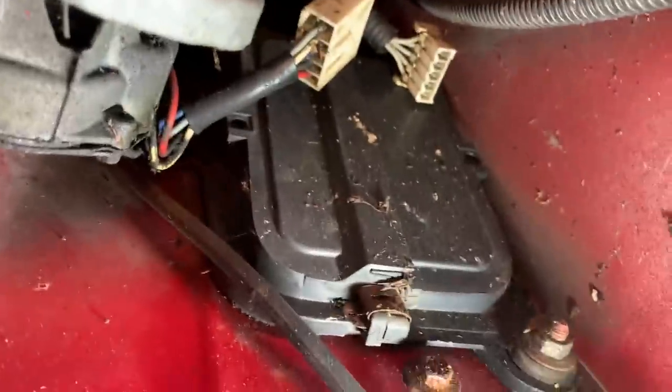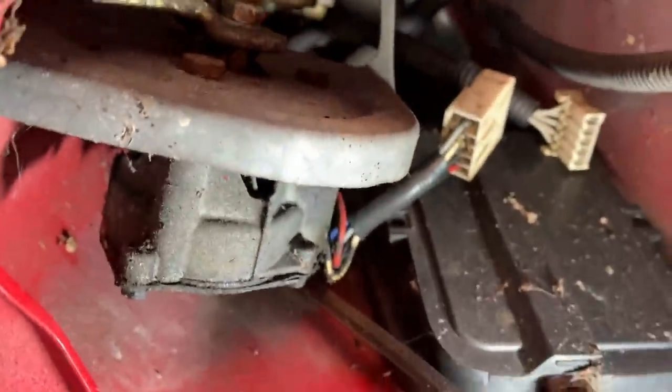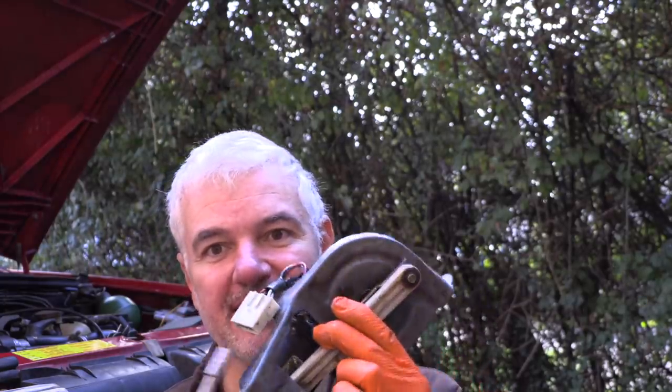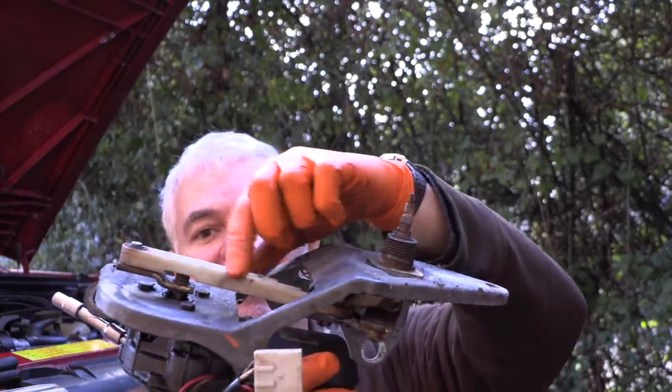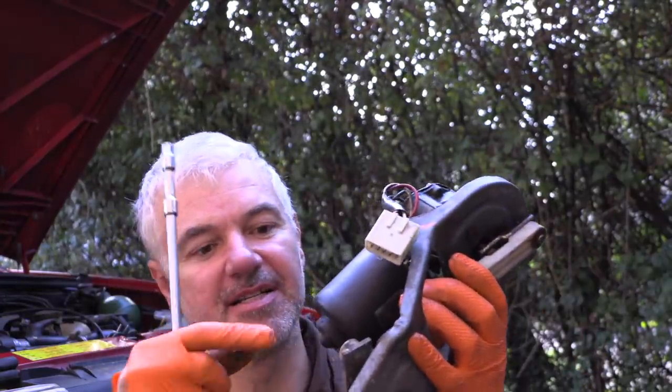There's the wiper, and there's the plug I've just disconnected. It doesn't look corroded but I'll give it a clean - I suspect that motor will need changing. I hope it's not a massive job or difficult or impossible to get hold of. Got to commend the Frenchies - taking the whole mechanism out was really pretty quick, just a few bits of body trim and then three bolts and it was out. I want to check if the mechanism is the problem, if these are stuck or seized, so I'm going to take the motor out and see how much effort it takes to move it without the motor in place. With the motor in, obviously, you can't move the mechanism unless you start the motor up.